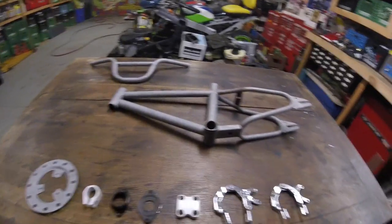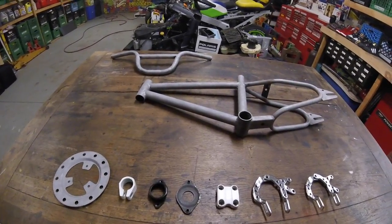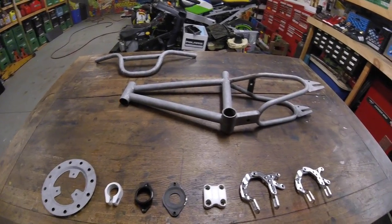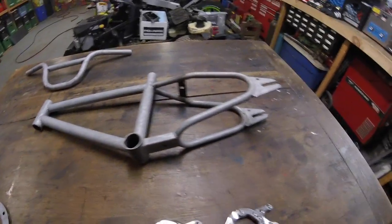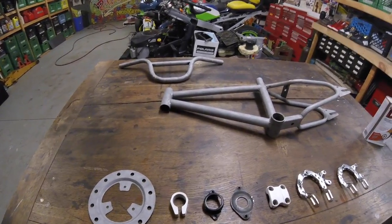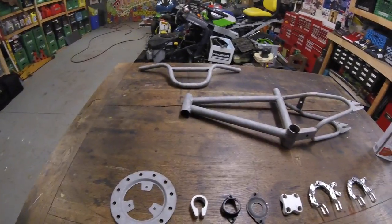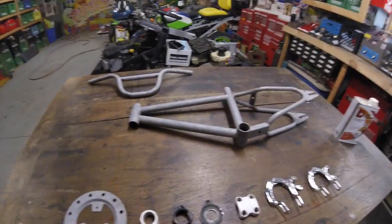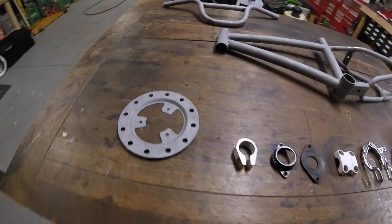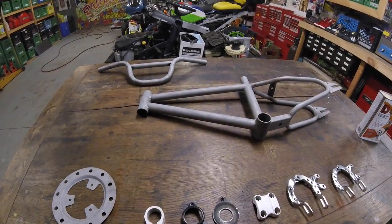Okay, quick update to get you up to speed. Last night I mentioned planning to strip the frame with chemical stripper — this gel formula right here — but I opted out of that because I didn't have time. So instead I set up my sandblaster and sandblasted the frame bars and chain guard. Those needed it because they had many layers of spray bomb on them.